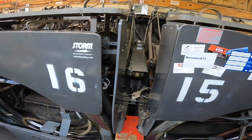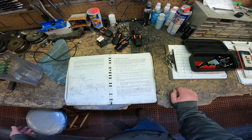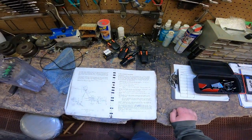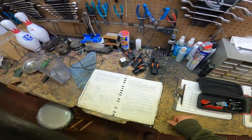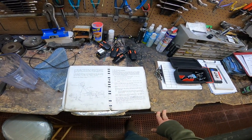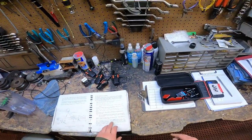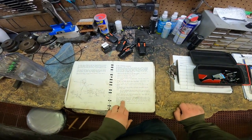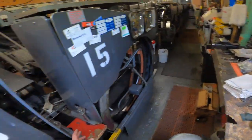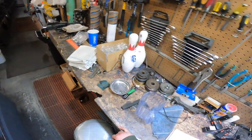Go ahead and start the accelerator, let it run through, and then send a ball. It says: start the accelerator and run with no ball, then check the belt tracking. Maximum permissible belt wobble is an eighth of an inch. Belt should run one inch from the edge of the pulley. If not, loosen the lock nuts holding the rear bearing assembly, loosen the jam nut and accelerator screw, and move the set screw. Once your belt is changed out if needed, and adjusted and running right, that's that.